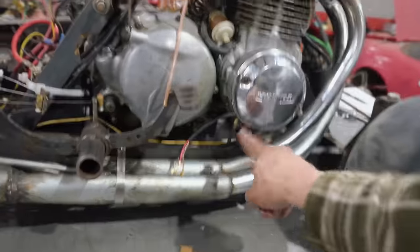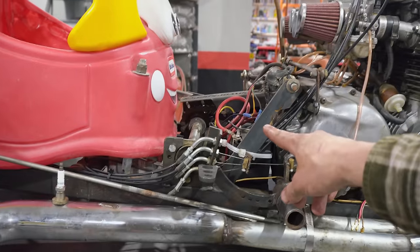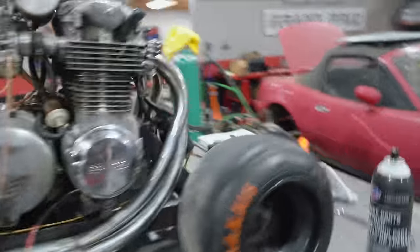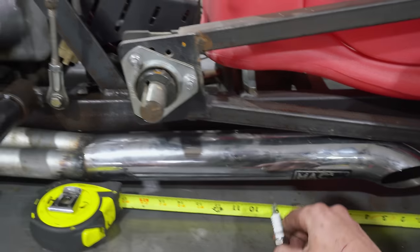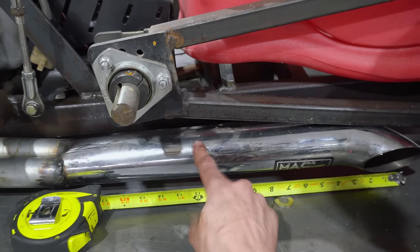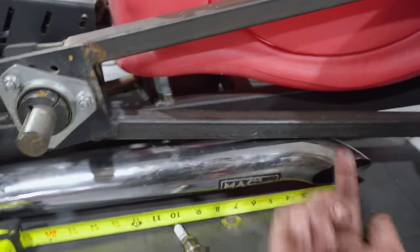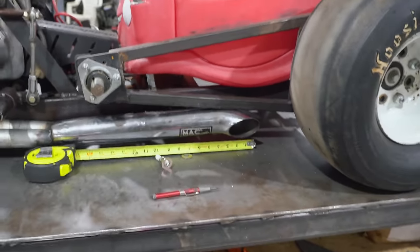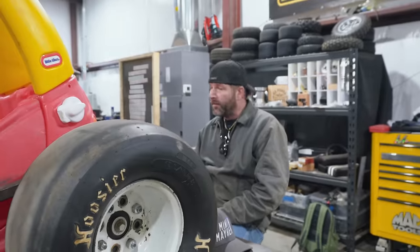While Ike works on the wiring from the ignition system slash pickup to the coils, I need to work on the exhaust system for the spark plug. I need to make it accept our spark plug somewhere right around in here. I also need to cut a slit on the bottom side of the exhaust and dent this side up so it's like a ramp — the exhaust goes over it and creates vacuum to pull fresh air in — because we can't have fire without fuel, ignition, and oxygen.